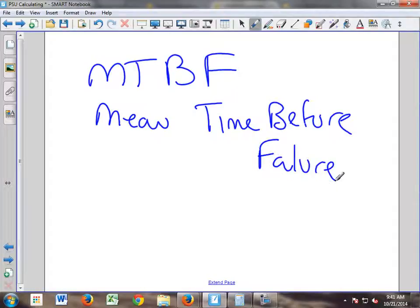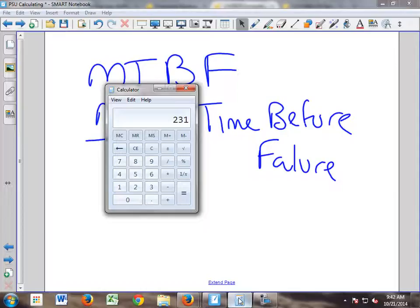Okay? It means that, on the average, it's the mean. It's not the most; it's the mean. You're going to get 100,000 hours out of this. Let's see, what is 100,000 hours, Mr. Poole? How long does that mean it'll last? So let's do some calculations. If we put 100,000 in, and I divide that by 24 hours a day, divided by 365 days in a year, it's going to last 11.4 years on the average.